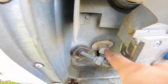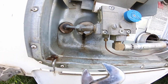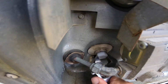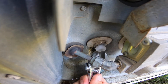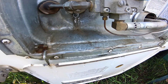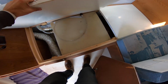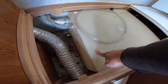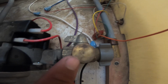Okay, so in here we've got this guy, which they always put in the most awkward spot. In this case, it's right behind this guy, which makes it almost impossible to get at. So, inch by inch, and plastic thing to boot. There she goes. Now the next thing we need to do, once that's finished draining, is drain the big water tank, which is this guy, and then open up this little valve and start pumping in antifreeze into there.